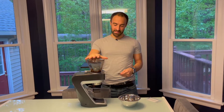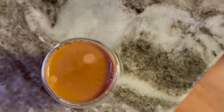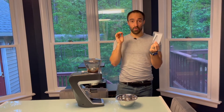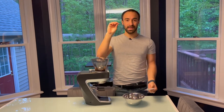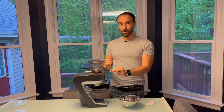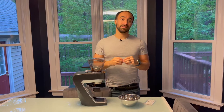I'm going to go ahead and bring this over to the counter and get started on the shim installation. We're back. I have the Baratza Sette here and my kit with the two shims. Every Baratza Sette comes with this whole setup. If you are using this grinder for espresso only, I highly recommend installing at least one of these. I'm actually going to install two — I've heard it accounts for about three to five full notches, so doing both gives us somewhere between six and ten.